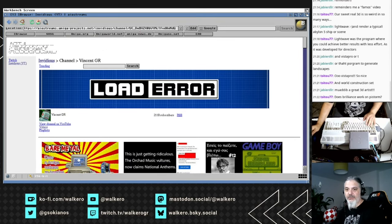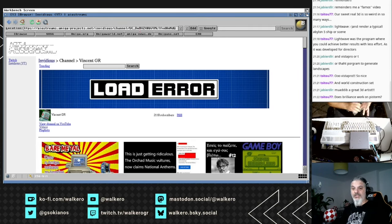Yes! So, we have seen a lot of things today, right? We have seen how to connect a PCMCIA CD-ROM on the Amiga 1200 and how to set it up to use it. We have seen how to use PlayCD from AmigaOS 3.9. We have seen how to install GroovyPlayer and listen to audio CDs straight from the CD-ROM, and how to rip music from your audio CDs to MP3s. What kind of application you should use to do something like that.